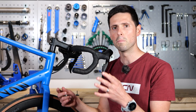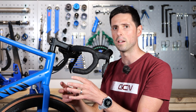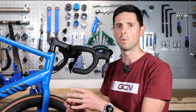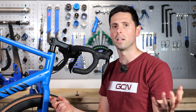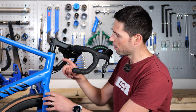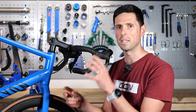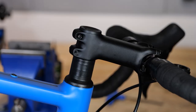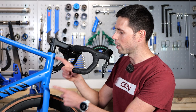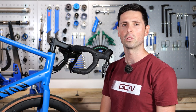The bearings used on modern bikes are sealed units with small individual ball bearings placed inside, fitted with a rubber seal. This helps keep the grease inside and any dirt outside. Fitted to your bike, you have the upper bearing and the lower bearing. They're sized and shaped specifically to fit different models and brands of bikes. It's important that you fit the correct bearing the correct way around to fit with a taper that is on the frame and on the lower portion of the fork.